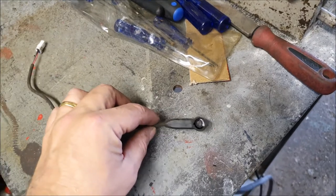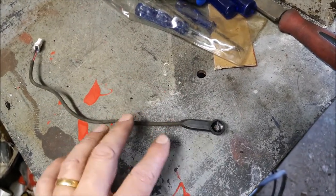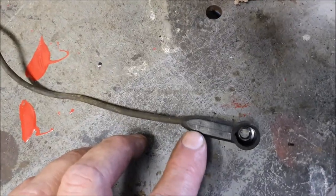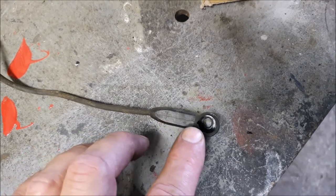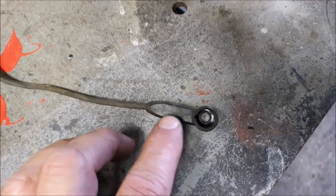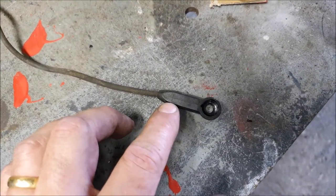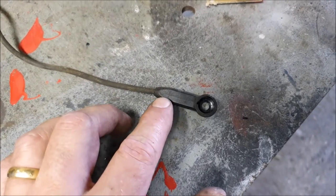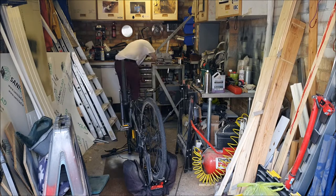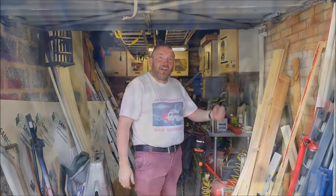I've been looking online and found a place that has a spare sensor listed, but they're out of stock - I've clicked the box to be notified when they're back in stock. I've also found some alignment instructions. There is a little mark on the sensor showing where the magnet is supposed to pass. It was passing sort of in the middle because it had been shifted up, so it could be as simple as it still wasn't aligned correctly. I might just pop this back in, give it another test, making sure the magnet passes that little line - I'll feel like a bit of an idiot if that fixes it after all this.